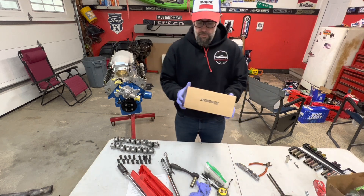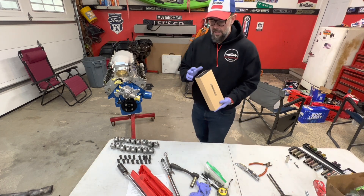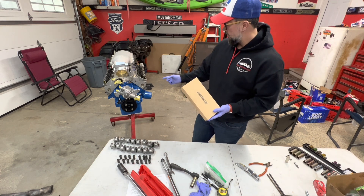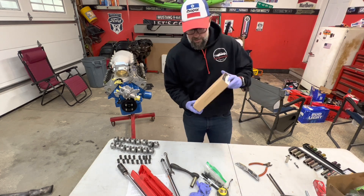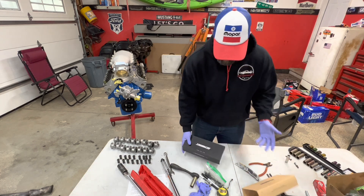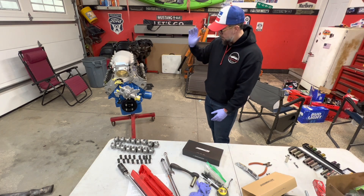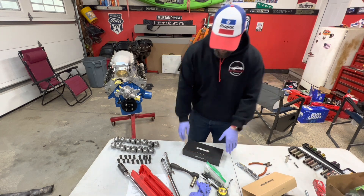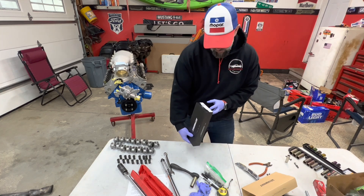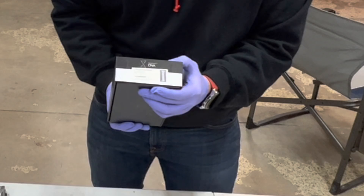Here are the push rods we got for this motor — these are from Speedmaster. These are the same guys that did the cylinder heads; I can't remember if they used to be Pro Comp and now it's Speedmaster. 6.30 is what ended up working for this application with these old Pro Comp heads, Anderson cam, and stock bottom end — it's never been decked or anything like that. The part number is 1-254-003.